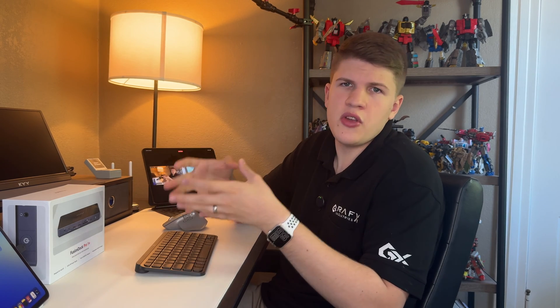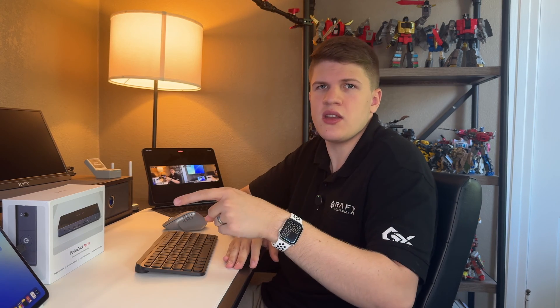Since I'm an iPad guy, I also showed the iPad connected to the dock — and it can use a lot of the dock's features. The big thing to note is that the second and third monitors will not work, as there's no iPadOS driver for DisplayLink. So whichever display is plugged into HDMI 1 on the dock is the monitor you'll get for the iPad. A note from future Micah editing this video: after using the iPad with the dock a bit longer, once it charged to 100%, it just stopped connecting to the monitor. I'm not sure if it's due to being on iPadOS beta. This dock doesn't claim to be optimized for iPadOS, so it's no fault of the dock or Ivanki. Definitely don't buy this for your iPad Pro — get it for your MacBook Air, and then you can give it a try with your iPad and see how it goes.